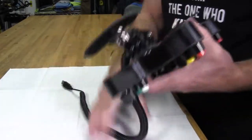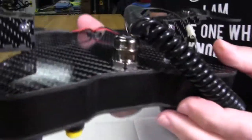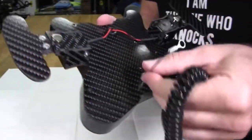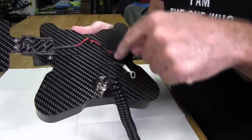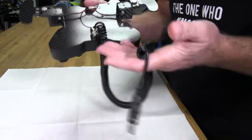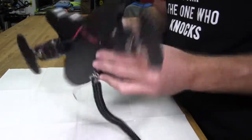Let's take a look at how the USB cable is put in here. It's got this nice metal piece — looks like stainless steel — very heavy duty. It's got one wire coming out that is a ground wire, and once we mount our hub adapter to these three holes back here, we'll put the wire through one of the bolts, which will give us a nice ground. There have been problems in the past with wheels and electronics where the ground causes weird things to happen when you do button presses or use a paddle shifter.